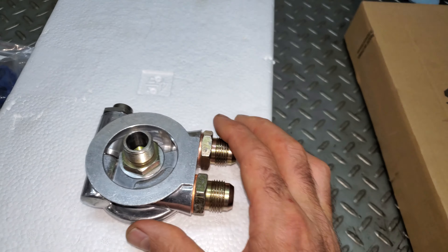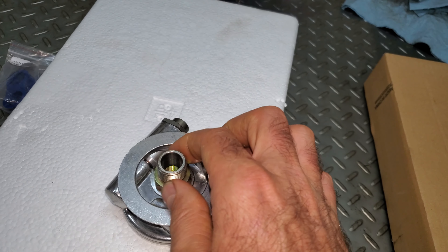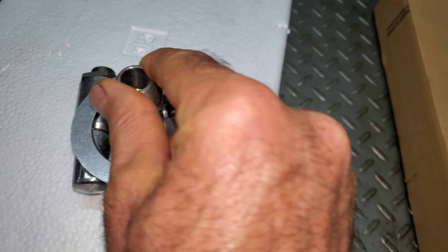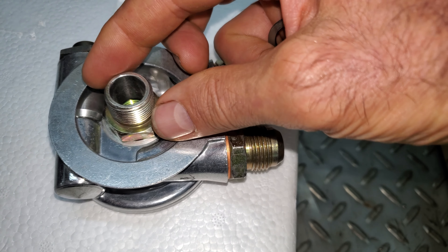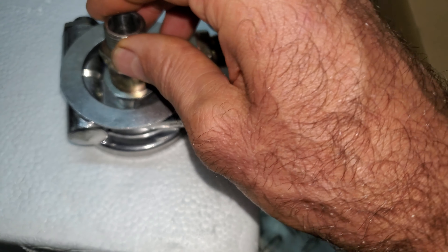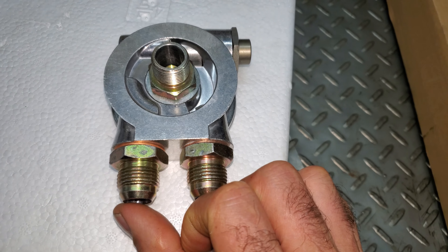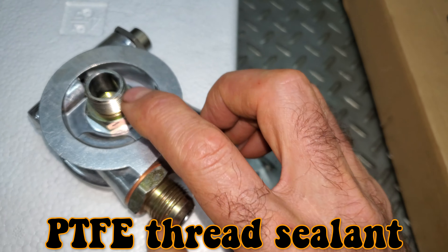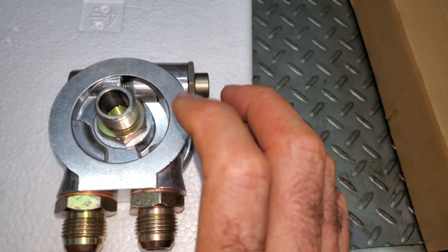I'm off to my oil cooler — I did a video on this thing. I put a different thermostat in it and made a washer for this thing too, because if I just put it in there and screw it down it starts digging into the hole and doesn't really seal all the way. So I made a washer so it's not gonna grind down the metal. I put some thread locker on here and found some copper shims and tightened those down, because I didn't like the rubber O-rings that came with it — the taper inside the body isn't right so it just tears those up.